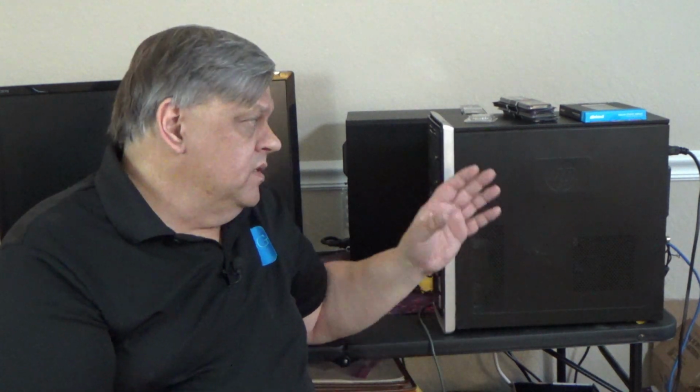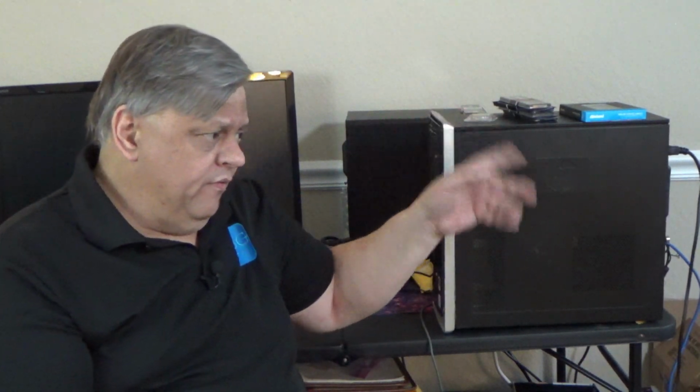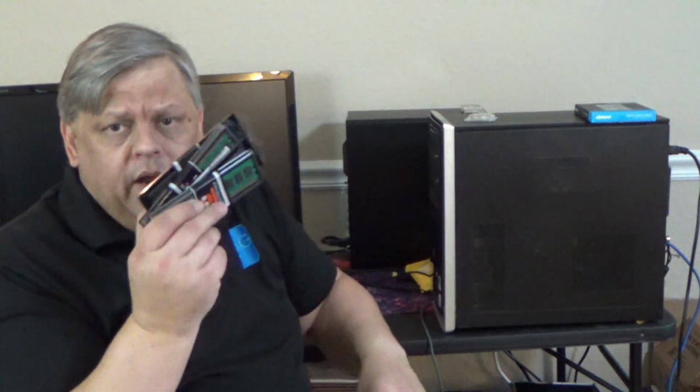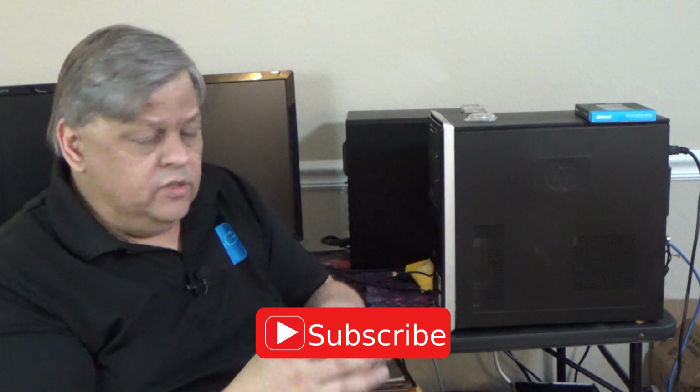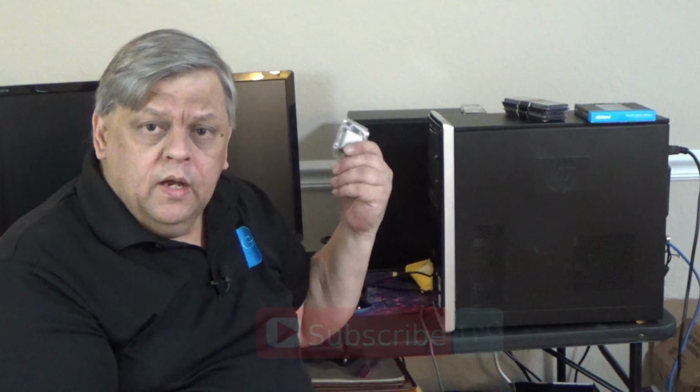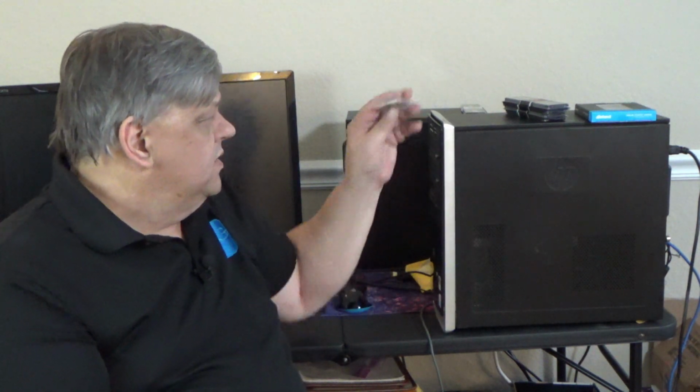What we're going to try to do, because she does not turn on right now, she just tries to cycle, and I'll show you that a little further in the video, is get her fixed, figure out what the problem is, and see if we can do some upgrades. First of all, we're going to go to an SSD, a 256 Inland. We're going to upgrade to 8 gig, so we're going to double the memory, because that's about all she'll take. And then we're going to upgrade to a Q6600 by Intel, and see if that helps, because that's a quad core chip.